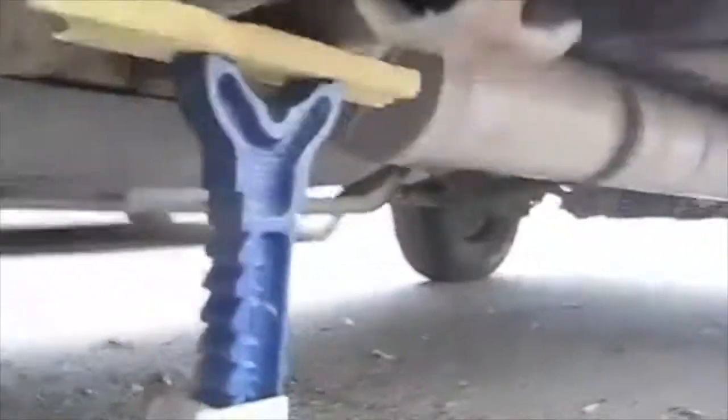You're going to jack it up. I've got my little piece of wood here. These are ATE brakes — there are no circlips on here, and it says ATE right here. This is what the backs of them look like. Pads are just about done, rotors are done. Now we're going to take off these caliper bolts — here's the bottom one, here's the top one. They're torqued to about 115 foot-pounds, and they're 19mm, or three-quarter inch for those of us in America.